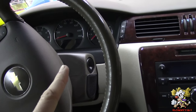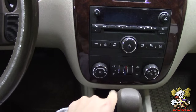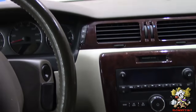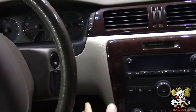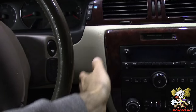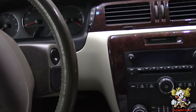In this video I'll be changing the driver's side heat door actuator. Pretty much any time you change the heat level on the driver's side, that's when you're going to hear that clicking noise. The ticking noise is in this area over here — the driver's side actuator is actually under there but the noise travels up, so let me start the car and you'll hear what I'm talking about.